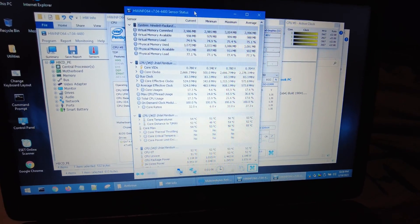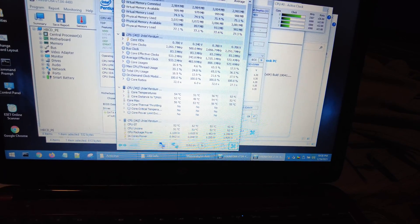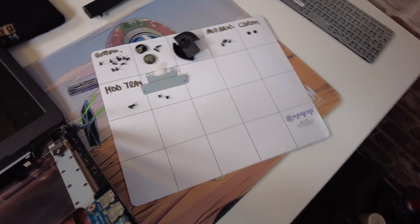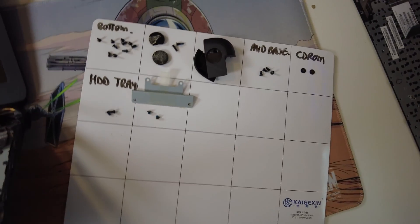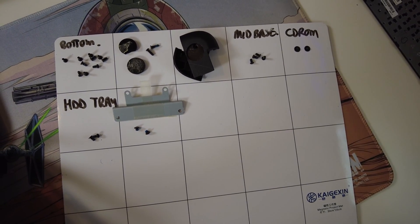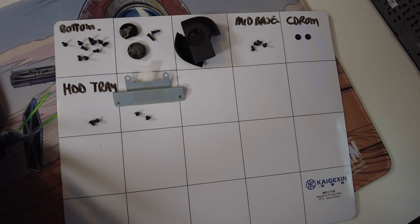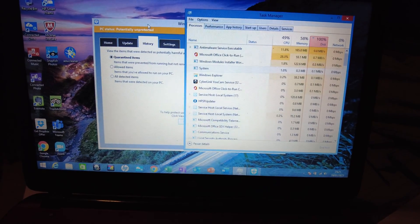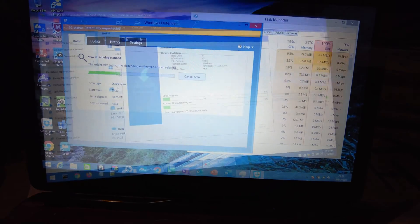With most of that done, it's actually running okay-ish now. Obviously this is an older system — only a four-core processor, only four gigabytes of RAM — and we're still struggling with that spinning rust drive. It does seem to be working; you can open a program and eventually it will open, but we'd still like it to be a bit more snappy. I've looked at potential upgrades: doubling the RAM from four to eight gigabytes is possible, although with just programs running it's only using about 50% of RAM. What I think is going to be crucial is swapping out that spinning hard disk drive for a modern SSD.